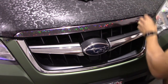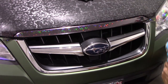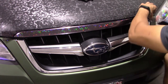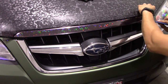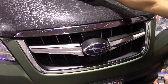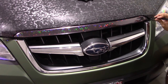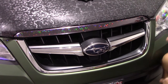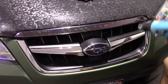Now that I had it laid down, I used my squeegee and my hand to smooth down the vinyl and tuck it into the top part and then under the bottom. Working at a corner, I hit it with a little bit of heat from the heat gun, and now that it shrank back and softened, I'm molding it in and around that corner, tucking it into that edge between the hood and the chrome bar.